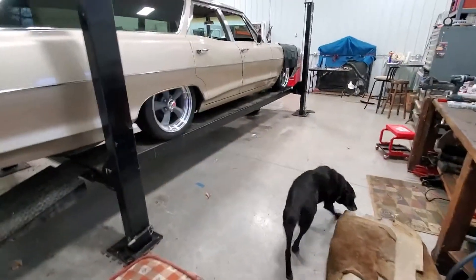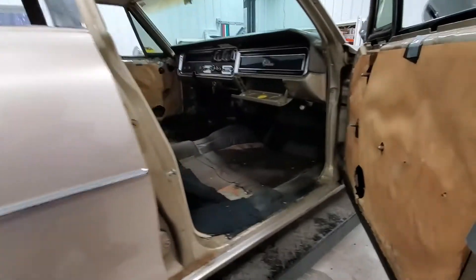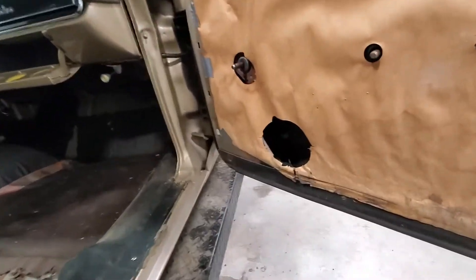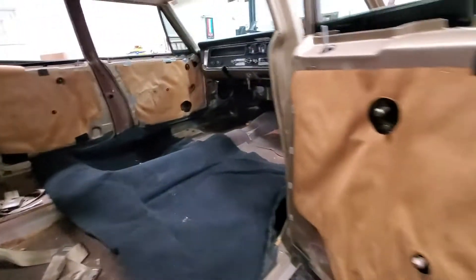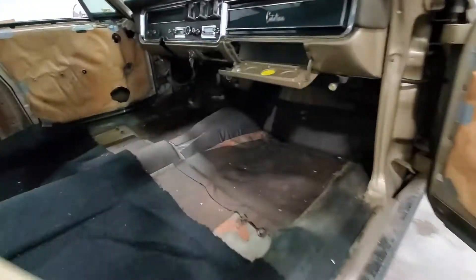In a bean-dog-approved video, we're going to add a little more to the end here. We wound up doing a little bit more and got more of the interior stripped. Trying to figure out what we're going to do to deal with these holes they cut for the speakers — probably going to wind up going custom on the door cards, which isn't our favorite. We're starting to verify how we're going to do the fit on the carpet, because a wagon goes back further because of this mechanism, so we'll have to splice some carpet in. The column came out pretty easy, nothing crazy there.